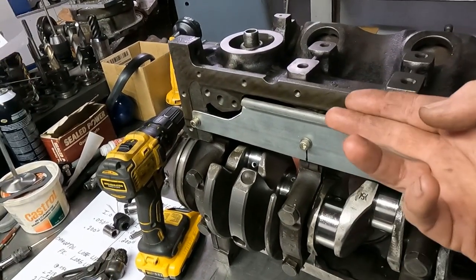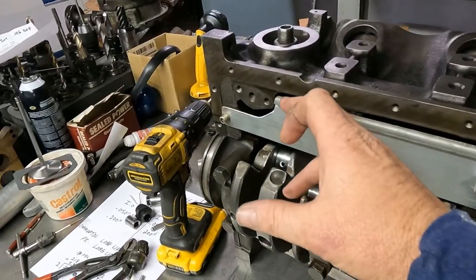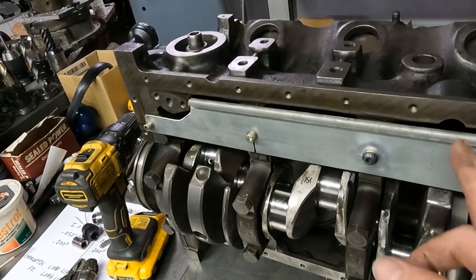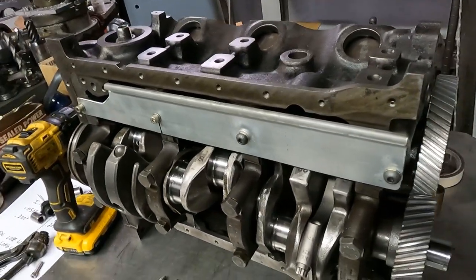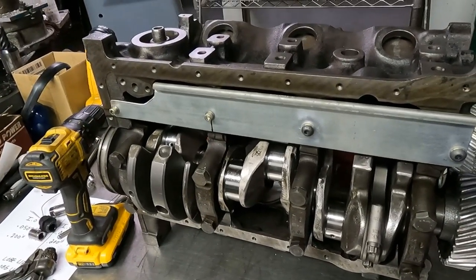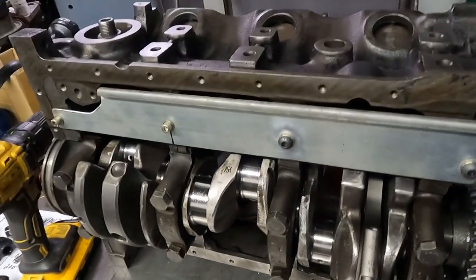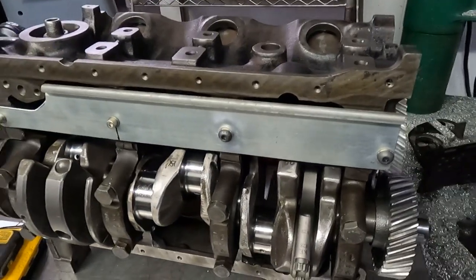Typically the crank cases and pan rails would be fairly similarly spaced with the crank pretty centered. What they're doing in the V8 world is building pans with a big pooch out on the side — it covers the bolts and they weld tubes in the pan. You need either really long bolts or plugs. But because of the way the 2.8 is built, it already has this natural offset, so my logic was: take advantage of it.